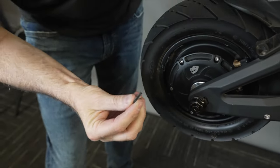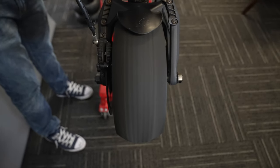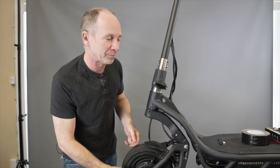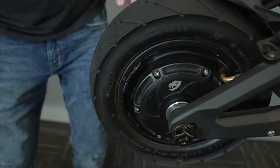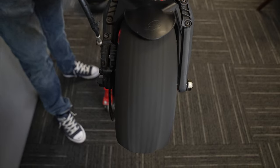Now that we've found our spot, it's time to fine tune the amount of weight. We've got two weights on — take one off and see if that's better or worse. One weight instead of two in this spot didn't feel quite as good, so we'll go the other direction and try adding weight instead. That feels the best so far. Keep going until you find the weight that works best, and you might go beyond and then come back one. In this case, three is the correct number of weights for this wheel.